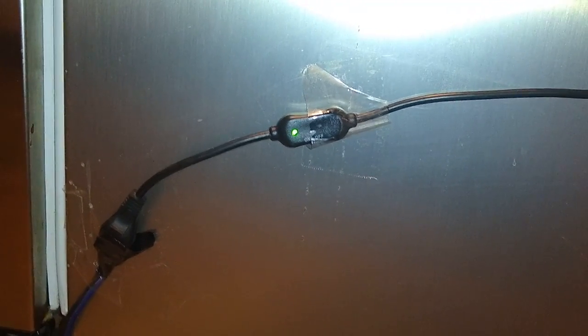There was three wires that you use. It's a four-wire fan system. Three of the wires you use. One is a red wire, one is a yellow wire, and then you have a brown wire. So the brown wire for the freezer fan is the ground, and then the yellow and red wire need to be combined to 12-volt positive DC, right? So this cord, this cable wraps around here, and it goes to this.